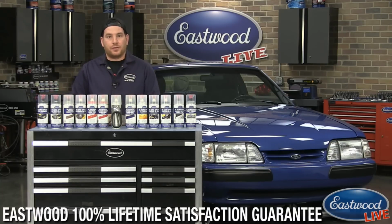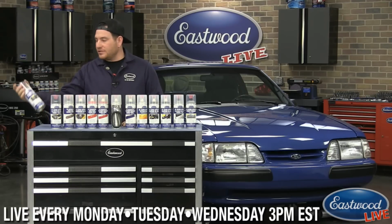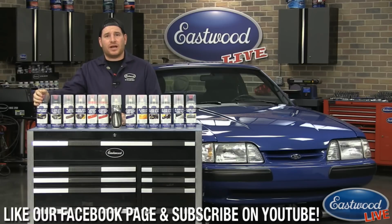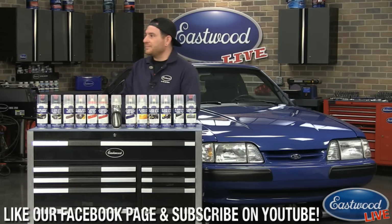But yes, you can do your body filler. If you're doing your metal work, or doing a skim of body filler, and you like to do it right on the bare metal, you can do that. Do your sanding, get it knocked down, get it nice and flat and feathered in, and then you can use our epoxy primer to spray right over top of that. It's going to seal up the bare metal. It's also going to seal up your body filler repair, so no moisture is going to get in there and cause an issue. So epoxy primer is probably the one I use the most, because I keep these cans, and whenever I'm doing repair and I want to seal it up, that's exactly what I do. So yeah, it's a good one.